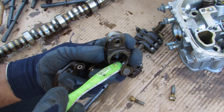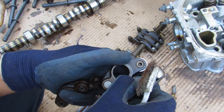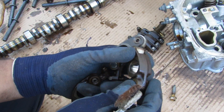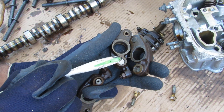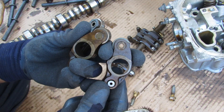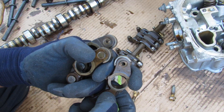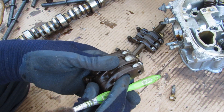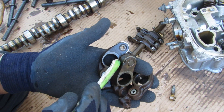That oil pressure flows into the first rocker arm through a hole and activates a small piston that pops out. That piston then pushes over to the second rocker arm — the one that follows the large cam profile in the middle — and pushes on a pin there, locking those two together since one is halfway pushed out and the other halfway pushed in. The third rocker arm has a spring-loaded receiver, and the pin pushes from the secondary one into this receiver, locking all three together so they all form a sandwich and move at the same speed. The return spring then helps push the piston back once oil pressure reduces and VTEC disengages.